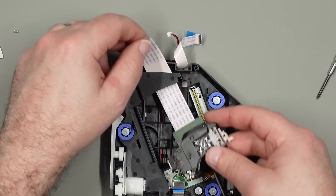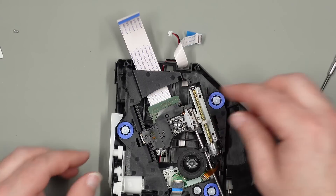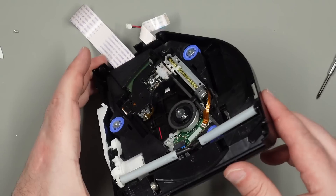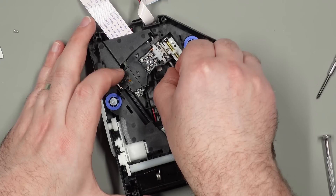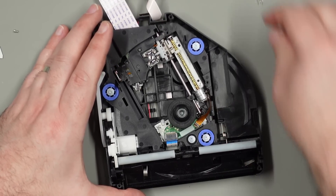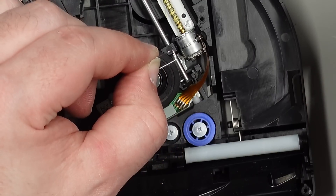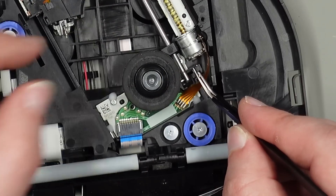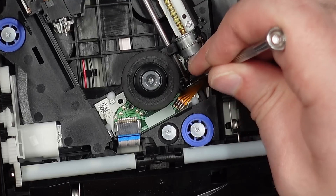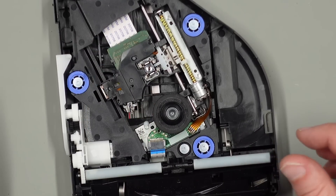Reinsert the flex cable back under there — there's a little black plastic lip that needs to go under this rail, so put it in this way first and it should drop into place. Reinsert the other rail — there's a little hole in the laser assembly it should slide into — and push it all the way to the back, flush with the metal piece. Get this little clip back in: the curved part goes downwards, get the rear flat piece under the plastic first, then get the straight part under the other bit of plastic so it locks into place. Everything should slide smoothly, then put the cover back over the worm gear.